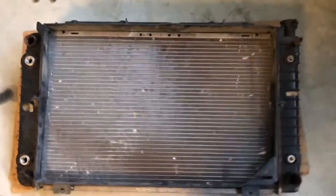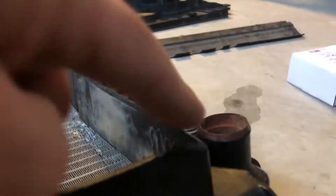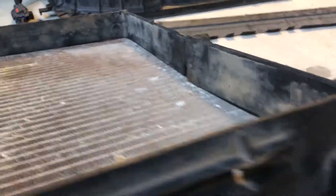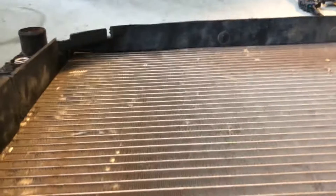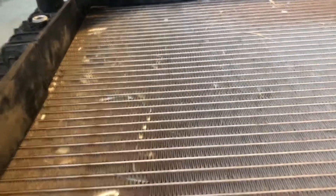What I'm working with is a 28-inch radiator — that means 28 inches between the tanks. What I did was get a fan shroud slash radiator support from a V6 truck out of the boneyard for about $8. I simply cut it where you have the transition to where it angles over to go to the big bell shape for the mechanical fan, and trimmed it across the top. You can bring the top out maybe a quarter of an inch to give you a little bit of extra meat to work with when you get it all together and get the fan assembly carrier attached.